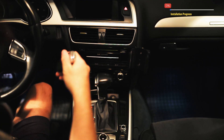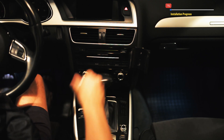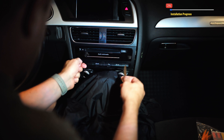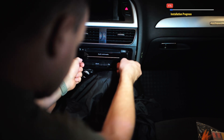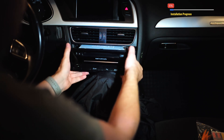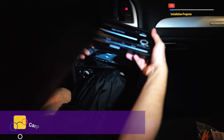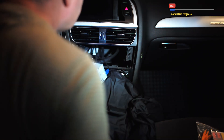The first thing is to protect all this area from scratching. You put the key tools here, here, and here, and pull — you see it clicks, then you pull it out like this. Below you have one cable. It's good to take a picture of every cable so we don't forget where it is.